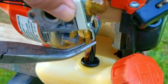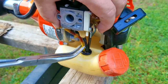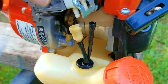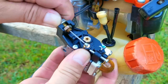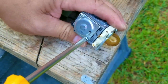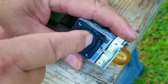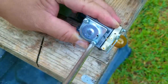Before I put the plate back on, I'm going to quickly replace the fuel lines, because they've gotten a bit smaller, which is causing a leak at the grommet, and they've also hardened over time. The grommet itself is just fine — it's only the lines that have been damaged. I'm also going to take this opportunity to inspect the carb for a bad metering diaphragm. The diaphragm's job is to control fuel flow through the carb, and if it's gotten petrified over time, it won't be able to do that. Luckily, the diaphragm is under a metal plate, so it's not difficult to access. The diaphragm is in perfect shape — no signs of hardening and no wrinkles. I'll put the carb back together and move on to the fuel lines.